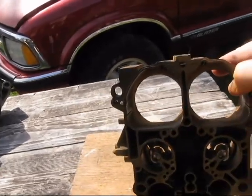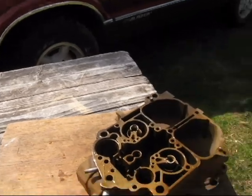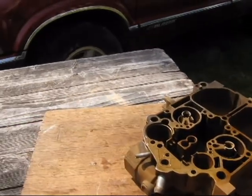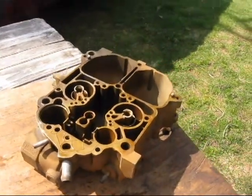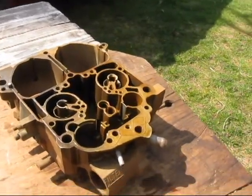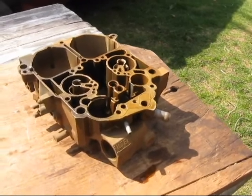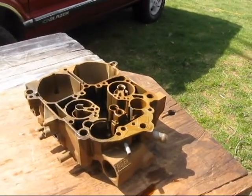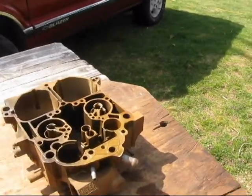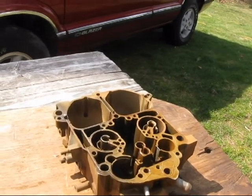I understand that it changes colors slightly after it dries, and you can see it is getting browner, but that's fine. Once the carburetor is on the car, it won't really matter — let that air dry. I know that if you buff up the zinc first, it comes to a slightly different color. I think I would have used a little bit less of the dye. It takes like four hours and then you can touch it. Leave it for a day and you're probably good to go. I'm pretty happy with the results. This coating will not come off once it's dry — it will oxidize over time and could last many years. This is what is oxidizing, and not the metal of the carburetor, because a lot of times what you see inside these carburetors is the metal just comes apart, especially as it gets older.